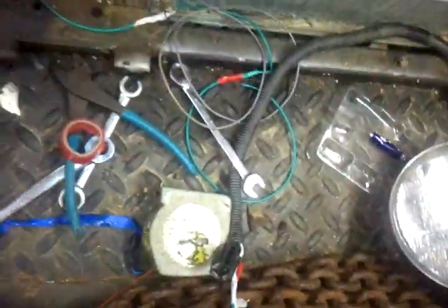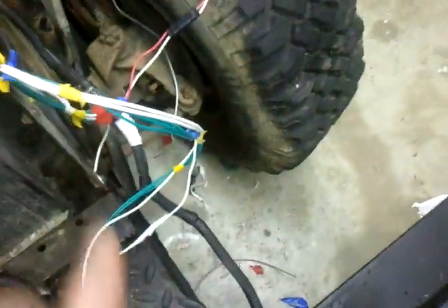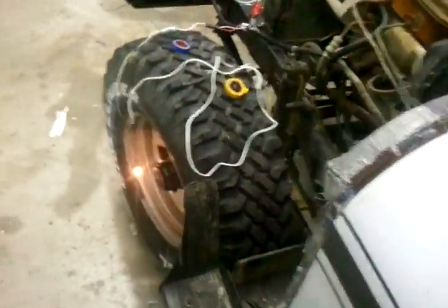I run through it tubing. They had a little ground wire right here running to the hood and a little ground wire right here running to the hood for the headlights. I run one solid ground wire up through there, so it's done like it should be done — not half-assed. There's the marker lights, there's the headlight.